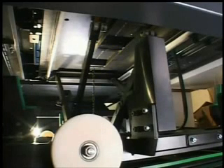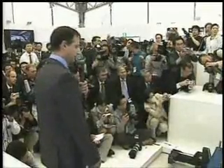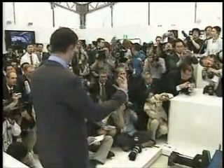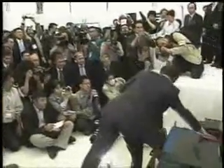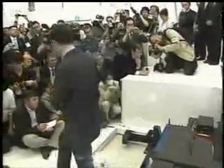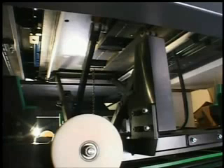What happens now is that the station computer connects to the computer onboard the vehicle and asks it if it is possible to release the battery pack. The onboard computer makes sure it is safe to remove the battery pack, meaning the electrical connector is no longer energized. The station computer requests permission to release the battery pack, the vehicle controller confirms it is safe, and releases the pack.